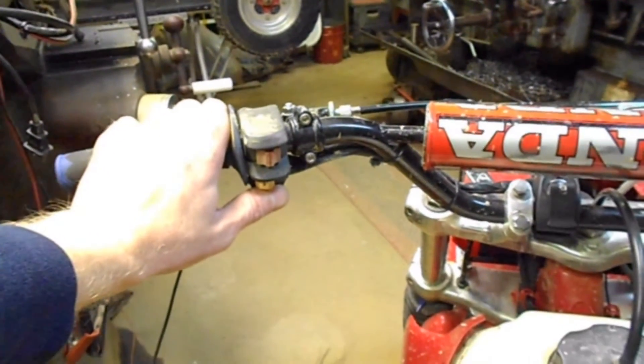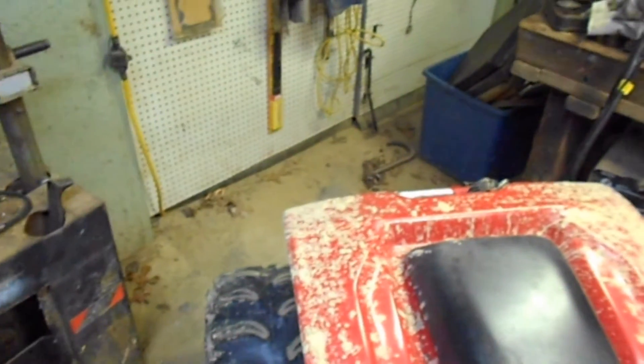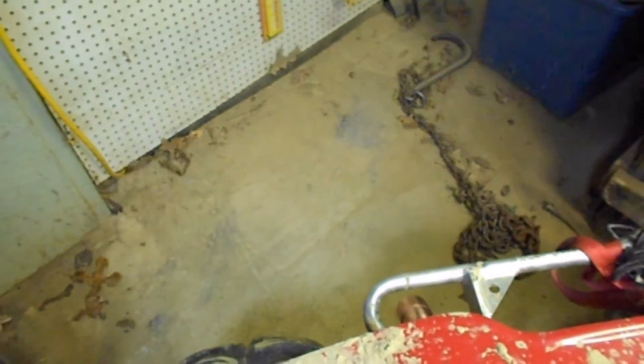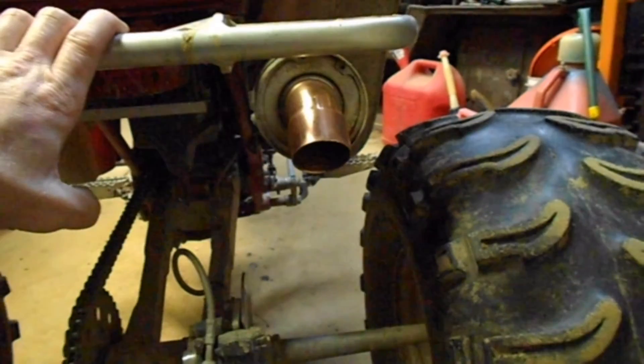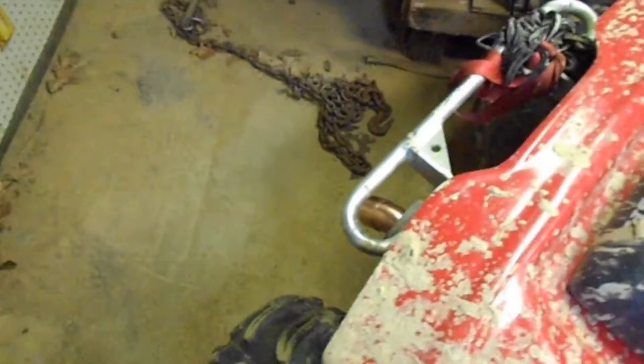This is the same tip I put on the 57, and what it does is shoot the sound at the ground rather than straight out like a gun barrel. It's basically for noise reduction — aiming the sound at the ground deflects it rather than coming straight out the pipe. It does quiet it down, but over a further distance, not standing right beside it.